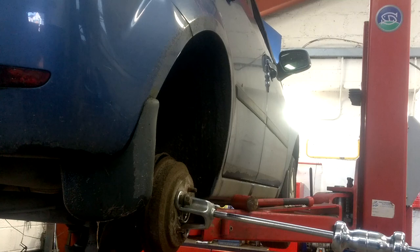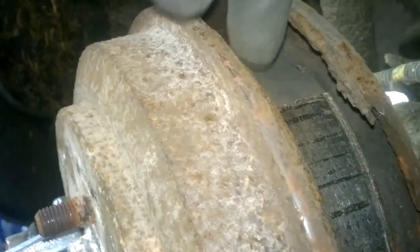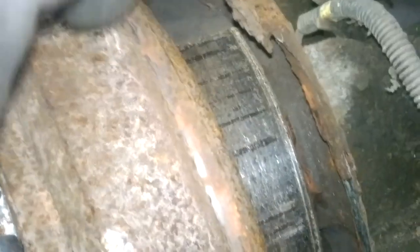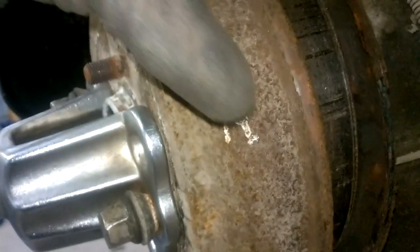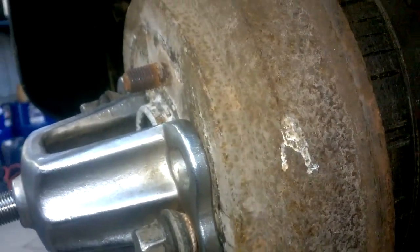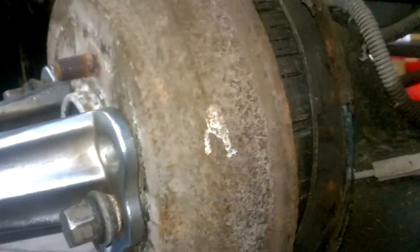In this case it seems to be coming okay. What I mean is: if you were to see the shoe moving out with the drum, you want to try and push a screwdriver or something flat in and get that shoe to release back away from the drum. If it's stuck that way, it won't damage retaining clips and springs as you pull back. I'm just going to pull this out a bit more and then it will be removed.